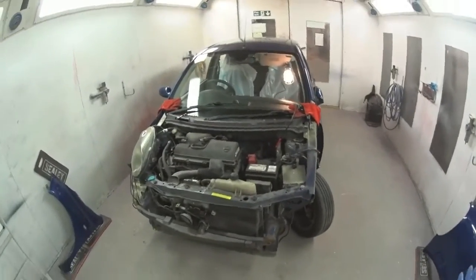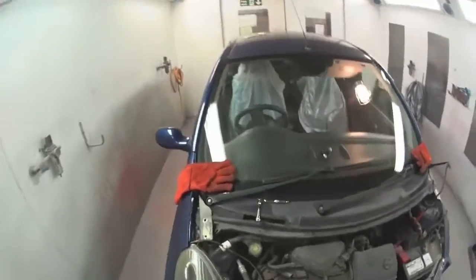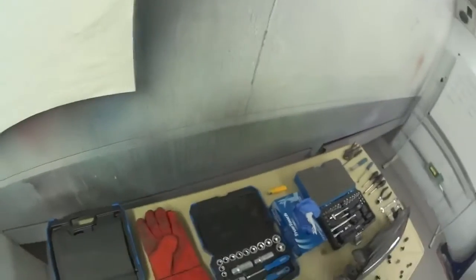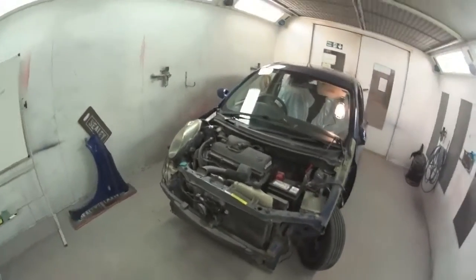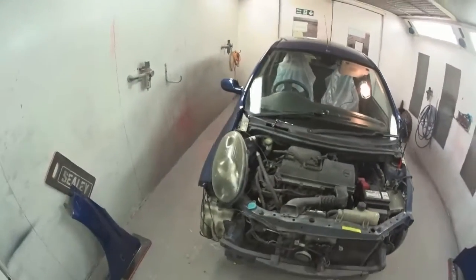Let's prop it nicely — it'd be nice to have a pad there, but that's going to touch long before the paintwork does. Bonnet off. I can't stress enough that I don't particularly like this technique, but I am on my own. If a push comes to shove it's a way around it, but there is a risk of damaging the paintwork or the window. Please be aware of that, and where possible get help. It wouldn't be the worst thing in the world to put some protection down there, especially when you're still learning — it is easy to make a mistake and damage things.